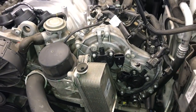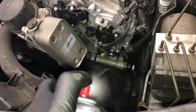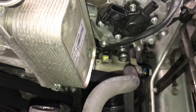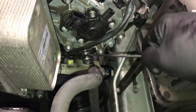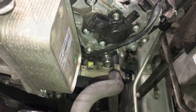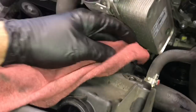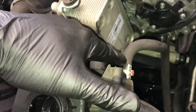Now that the cam adjusters are installed, we need to clean up the mess. Put a finger over the port where the power steering goes, then spray the whole area with brake cleaner to wash off all the spilled power steering fluid. Once the spillage is cleaned up, use a pick tool to remove the rubber O-ring from the pump, and swap it out for a new one. I'll link this in the description. Clean up the reservoir and give it a good wipe-down, especially the port where the O-ring goes — you don't want any sand or debris in there.